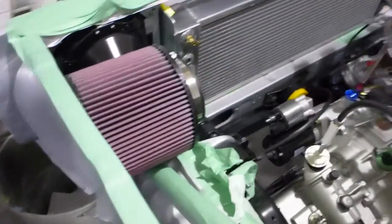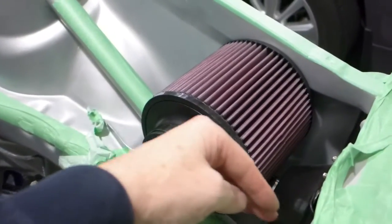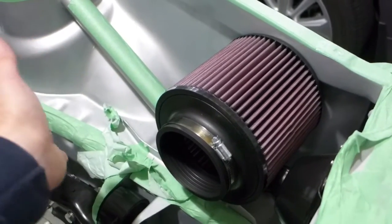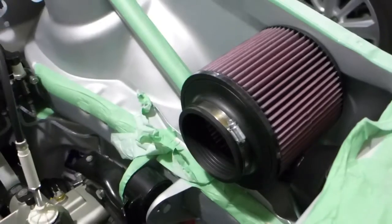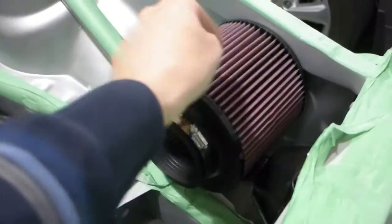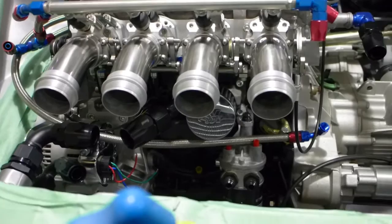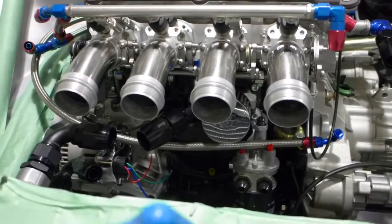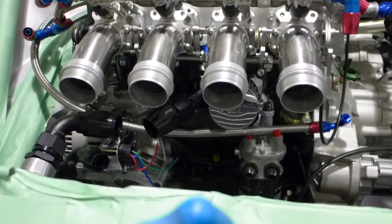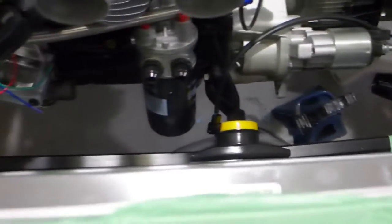You can see there's a plastic pipe that runs from the air box over to the air filter — that's where the K&N air filter is going to sit. There will be a clear polycarbonate shield to keep warmer air from the engine away from the air intake, going up to the top of the hood height so dry air comes from down and around underneath. It's a big 4-inch intake running to the polycarbonate air box that I'm going to be cutting, gluing, bending, and heating this week to get the whole intake system finished.